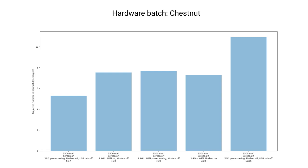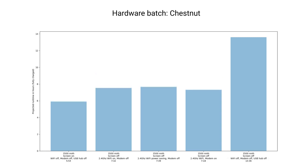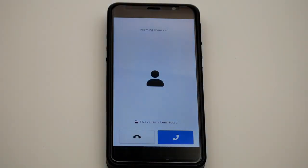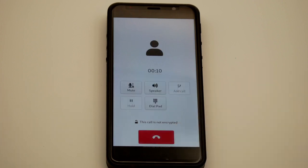To put it in a super power-saving mode, you can flip off the Wi-Fi, which will allow the phone to be powered for 13 plus hours. For any phone, keeping the modem on is crucial. Fortunately, it is possible to have the modem powered even with the USB hub off. The modem still sends interrupts to notify when calls come in, meaning a software solution to wake up the USB hub should still be possible.